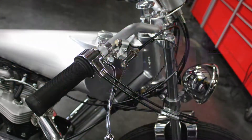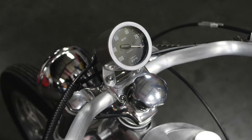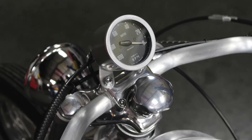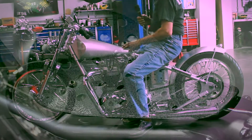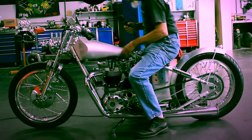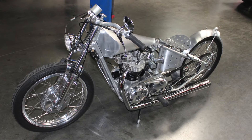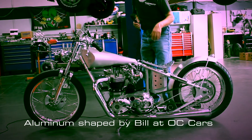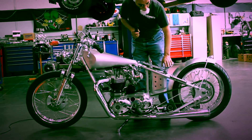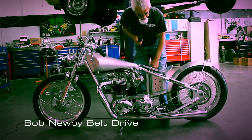The goal of this bike was to make it light. I have aluminum handlebars, an aluminum tank, and I didn't even want to paint the tank or put a clear coat because everything you introduce has a weight factor — I just wanted to keep that in the forefront of my theme. The tank has been sanded with 380-grit paper. The oil tank is vented with holes so it has an air-cooled feature cooling the oil, because the oil is what cools the bike. I've got holes in the seat, holes in the oil tank, holes in my primary case.